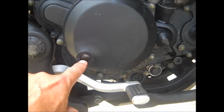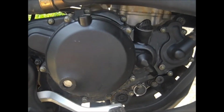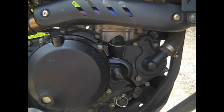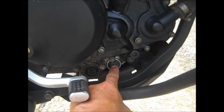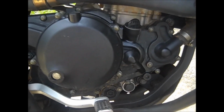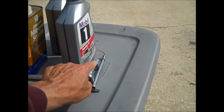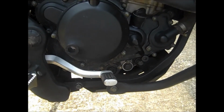Anyways, you've got the oil sight level here, with the scribe lines, the high and the low marks. So we're going to be getting our oil in that area somewhere. And then we have two oil fill caps here, but only one is required. We have some metal screens to collect particles. They're in here, and then my oil filter's here. It says I hope I have the correct tools, that I will need a 17mm socket and an 8mm socket, so I will be using those to take the oil out.